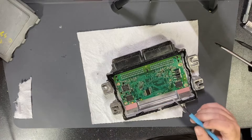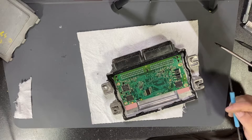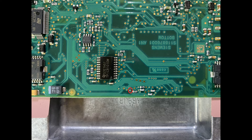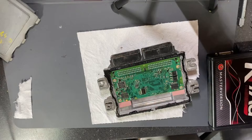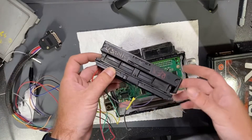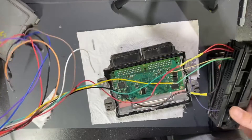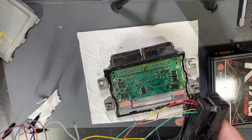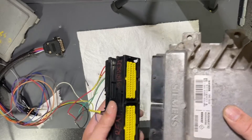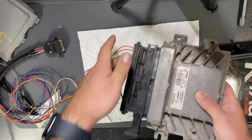The boot pin is on this area — I will add a more clear picture in the video. Since I've worked a lot on this ECU, I have a connector which is from Renault Sirius32N, prepared for the programmer. This ECU uses the same pinout as Sirius32N, so for me reading and cloning this type of ECU has always been easy — I only plug this connector in.